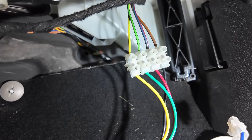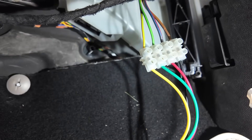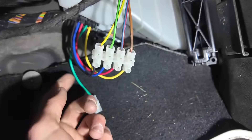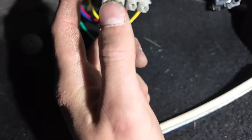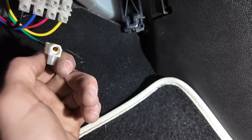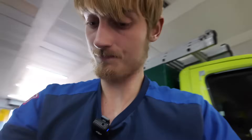So let's get that sorted out. Just for basic testing purposes I'm going to flip them around in this connection block, and if it does work we can solder it up at the end. I've rewired it properly — just to show you, I've flipped all the connections around. The blower motor resistor uses pins one, two, three, and five. They'd misidentified pin four and isolated the blue wire originally, so I've gone ahead and isolated the real pin four, which is the green one.